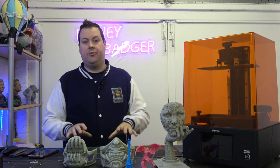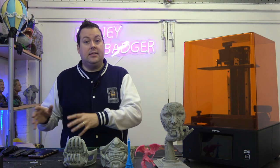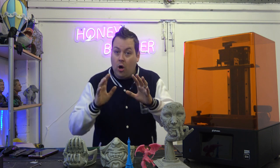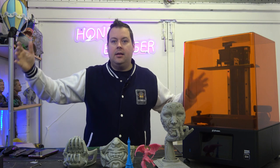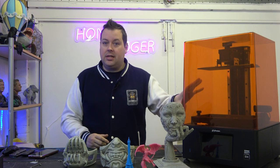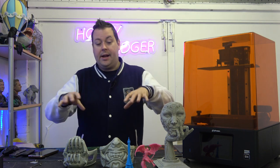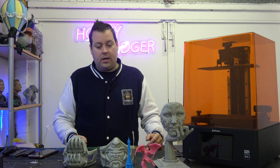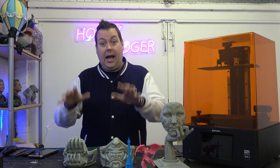We are incredibly happy with the detail this is turning out. The Mega is also 8K, but the quality from the Mighty will be better for smaller prints — 8,000 pixels condensed into this smaller screen size means a higher pixel density per inch. As a result, when you're doing minis, they will be a lot more detailed, and it is noticeable.